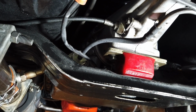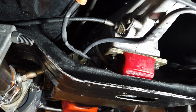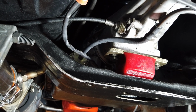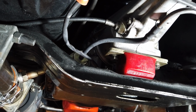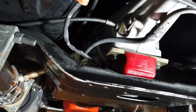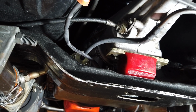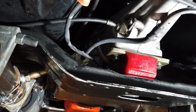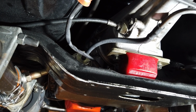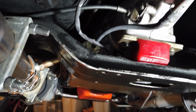Wow, yeah, lesson learned though, because it had been a while since I changed one of these things out. Just leave the cords loose until you are done tightening it down, because it'll want to spin the entire wire assembly. The whole mechanism just spins, not just the nut on the O2 sensor. So yeah, anyway, leave it loose, attach the sucker, and then run your wire. But that should do it for us.